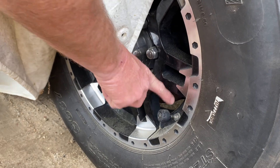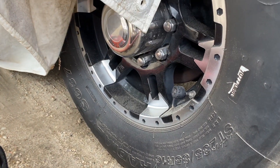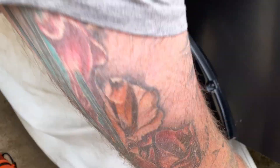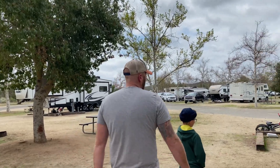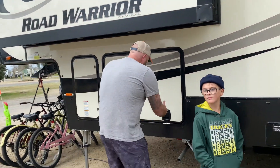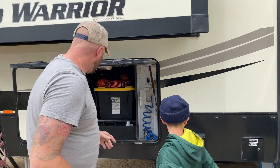These little sensors go on the tires for the TPMS system — they feed back to that control panel in the truck. It has totally worked. When I towed from the desert to here a while ago, I was over-using my trailer brakes, I heated the tires up, and it told me immediately that my tires were running hot. It tells you temperature and pressure — whether they've gone up or down. Works amazing because you don't know what's going on unless you're monitoring it all.